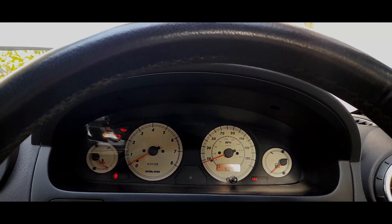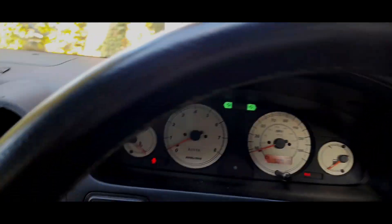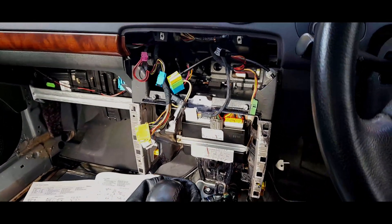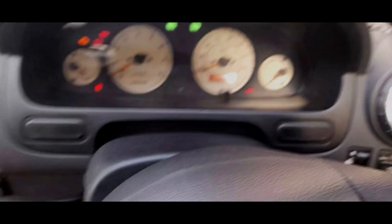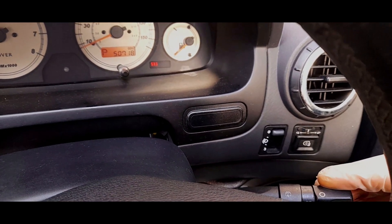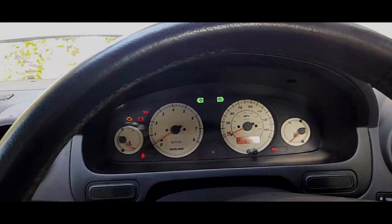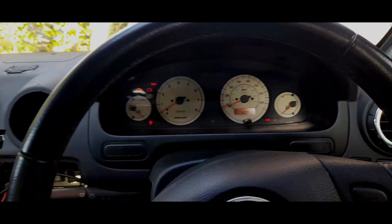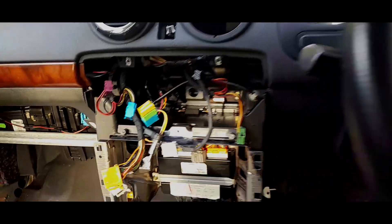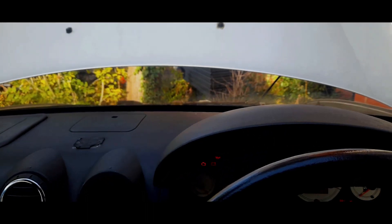What was happening before — the hazard lights were on — and now that's disconnected, the hazard lights are on again. That's fascinating and obviously part of the same circuit. No clicking, so that is definitely the plug. But interestingly, if I put that plug back in and put the ignition back on they won't be doing that. I need to work out which wire to test — I just want to test the wiper side of things.